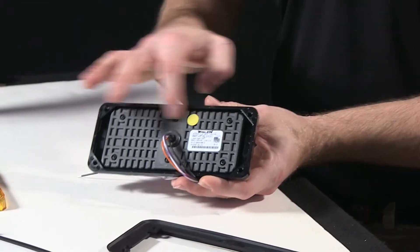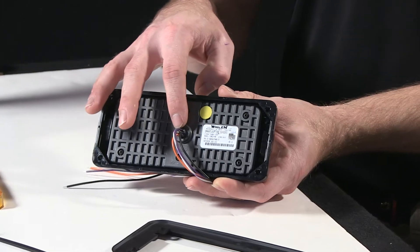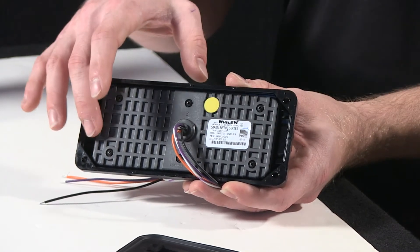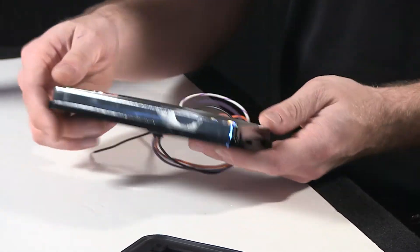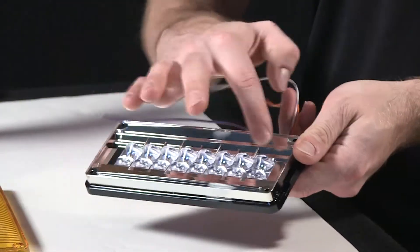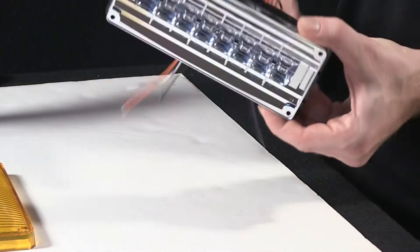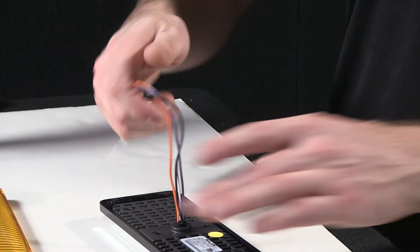The back of the unit has four screws — we'll remove those in just a second — and a center input for your wiring harness, which for mounting makes it really easy: a center hole versus something up in a corner or on a left or right side. The yellow dot here is a Gore-Tex breather, so when the whole thing is assembled and the lens is compressed onto it, the heat generated by the diodes is allowed to dissipate through the back of the housing. The pigtail wiring harness we'll get to once it comes apart and goes back together.